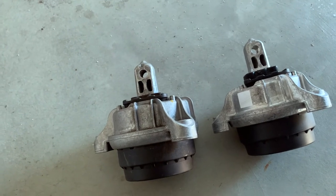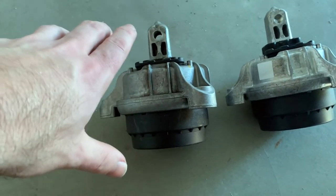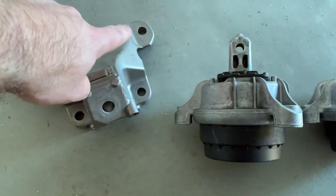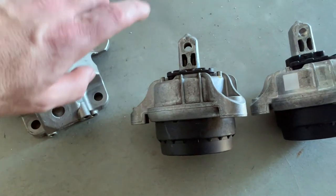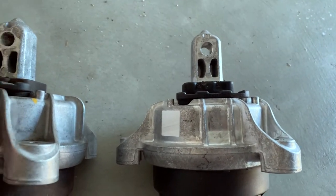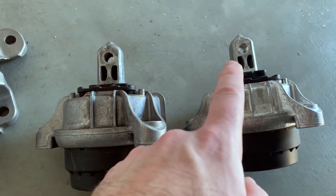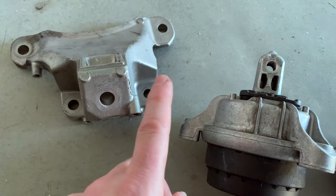I changed strategy after about an hour because neither of the mounts would come out. So I decided to take off the carrier - there are four screws, it's the same E14. For the top one these are supposedly torqued with 66 Newton meters, three are easy to reach, one is a huge pain. Now you can see the old mount and the new one - the old one is clearly further in, so-called collapsed. This also shows that you need some more wiggle room for the new one because it's going to be higher out.